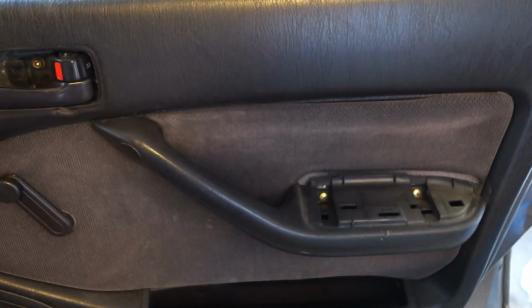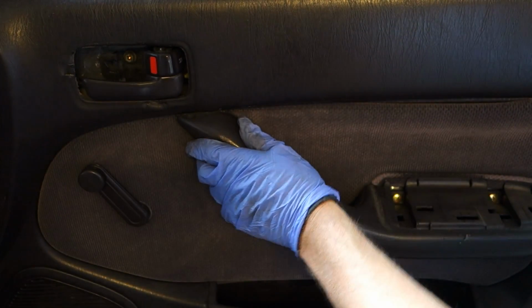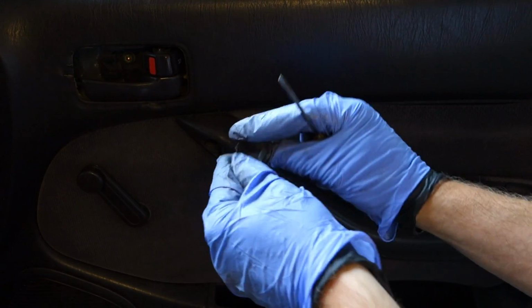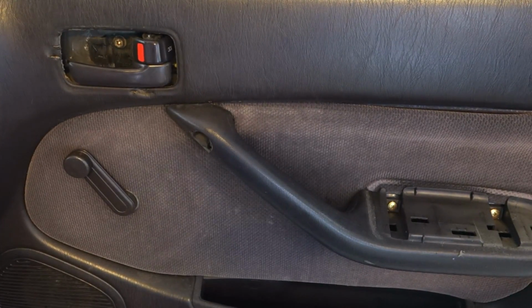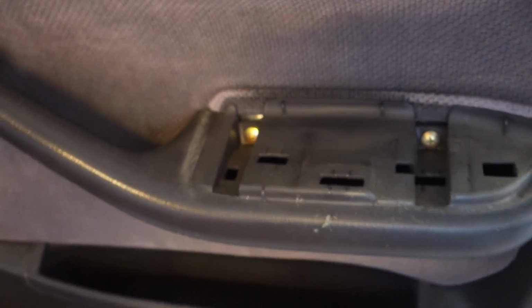And then next, in that area there is this cover, and I use my screwdriver, actually a little bit smaller one, carefully. And now it opens. There is the cover, and just behind this cover we can see there is a screw inside. There is a Phillips head screw, similar to the one in here. Next I must take these screws away, and let's do that next.